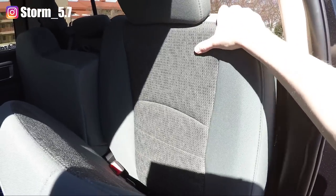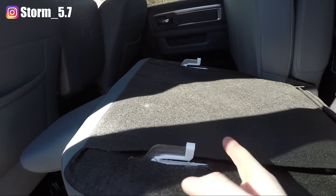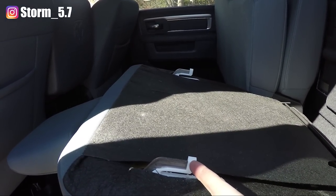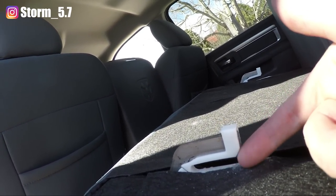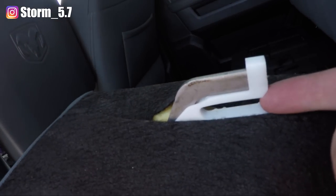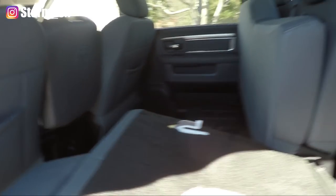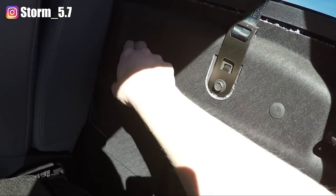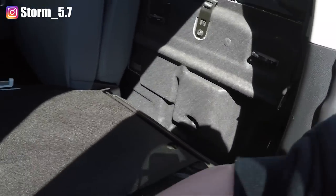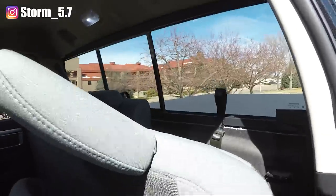So here's the mod we did: we cut this factory metal piece off flush to where it met this plastic, and then we put about a 45 degree angle on the bottom there so it slides on nice and easy. Just do that to both sides, take a file to the ends so they're not sharp and don't rip up the back of your seat. To put it back up, make sure the seat is at about 45 degrees, push the back down, push the seat down, and there you go — the seat's not going anywhere, simple as that.